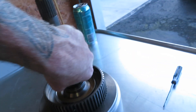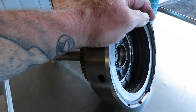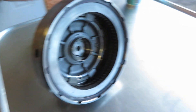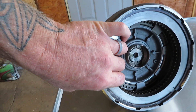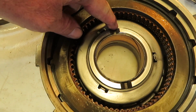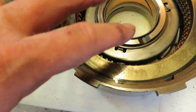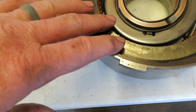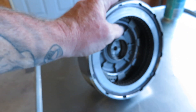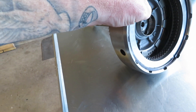First thing I want to do is get some clutches replaced tonight. We're going to change the input shaft to a billet shaft. We'll start with the forward clutches and get those done. There's an apply piston in here that you've got to change the lip seal on, and then we'll move on to the direct drum and get those clutches changed. There's a snap ring that has to come out - it's spring loaded - and there are some lip seals on an apply piston in there as well.